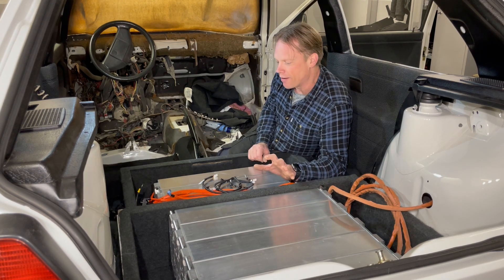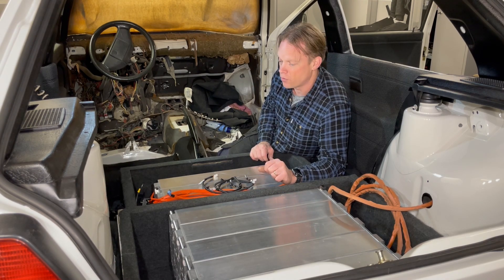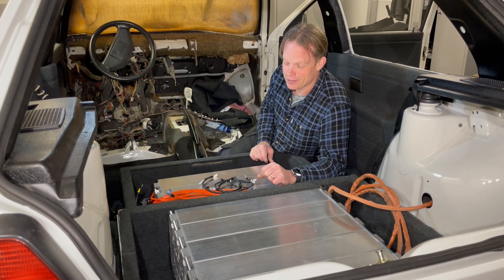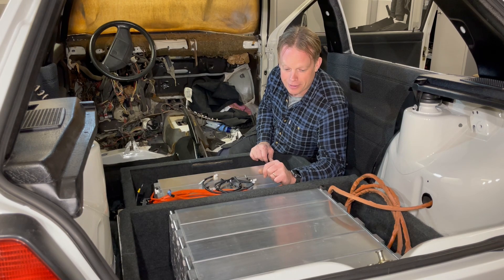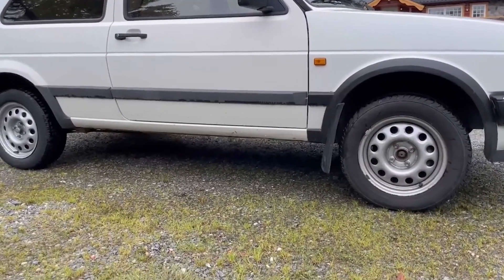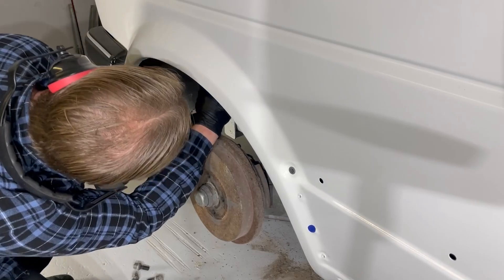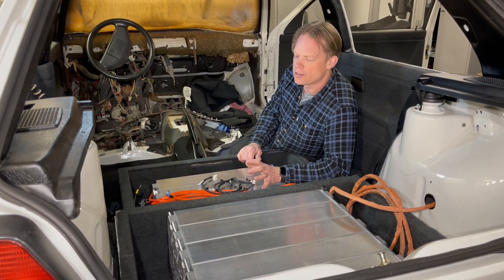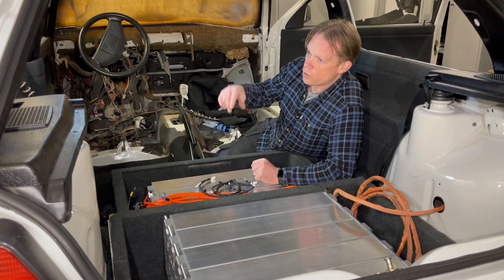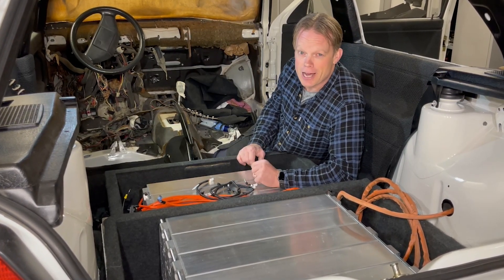It's good to now have the battery modules in place, so now I have the weight and can start to see how I need to adjust the chassis. That's also a big challenge. When I lifted out the old lead-acid batteries the car was sitting so high — I can't go around like that. I've bought some coilovers and installed them today, and I'm pretty satisfied with the height now. I don't want it too low, just a little lower than original so it looks nice. I still need to install the windows, motor, and the rest before I finalize everything, but I can already see how it will end up.